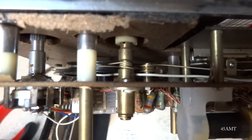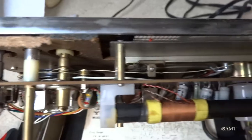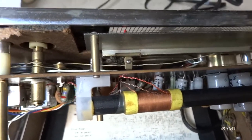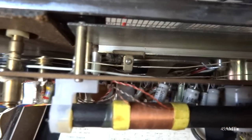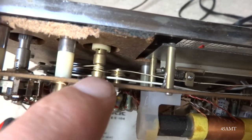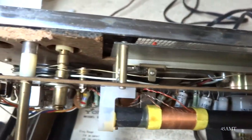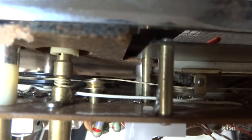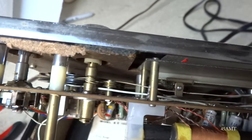If you had enough slack you might be able to tie it back together, but it probably wouldn't work because of the roll on it — it probably just needs a new dial cord. You've got to closely pay attention to how many turns on the tuner knob and how it routes. It looks like pretty much everything is still in place, so I should be able to take pictures and remember how it all wraps around.